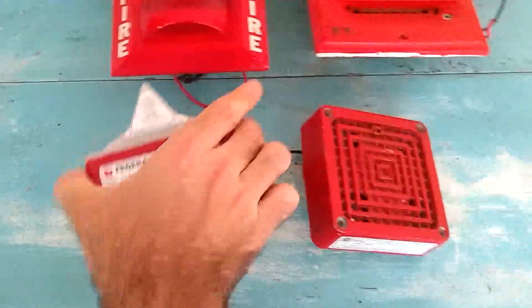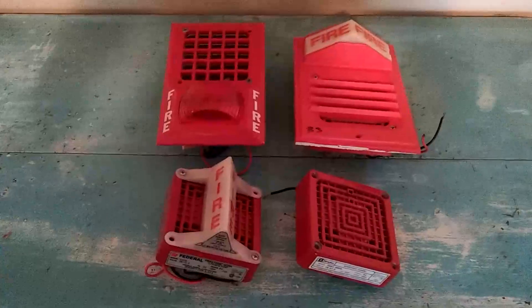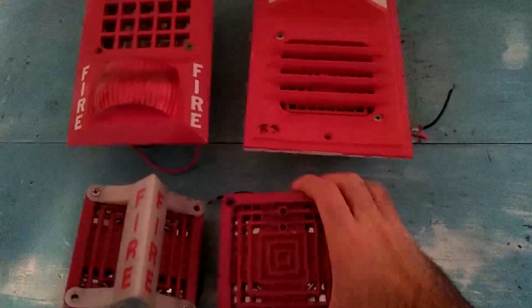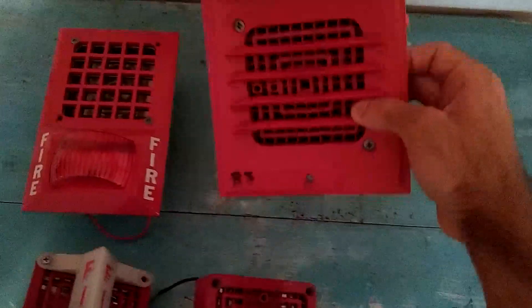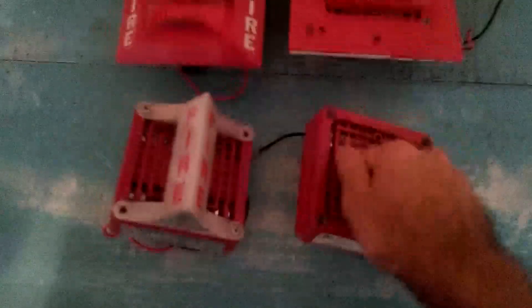Now these are also B-Series Vibratones. This is a Series B4, as is this one. This one has the original Federal Signal tag, whereas this one is labeled a 2901-9806, just like the B2. Sorry for the change in lighting as some clouds roll by, but these two are newer. They're both B4 Series, which can be distinguished from the B2 by this cross-shaped additional reinforcement here. You can tell they're newer by the glossier finish and unpainted sounder plate, but the B4 was actually introduced at the same time as the B2s, so you'll see some B4s that have the older color scheme and some B2s with the newer color scheme.